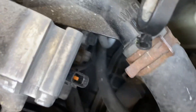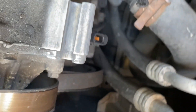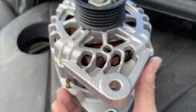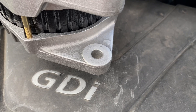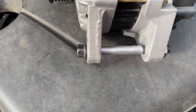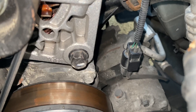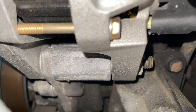You can see where I scraped all that coating off so it's bare metal. Flip this over — I'll show you what we did on this side too. All nice and clear, so that way it bonds to the mount nice and clean. Also cleaned this bolt really well — it had junk on it — so we have nice metal-to-metal contact mounting onto clean metal as well. With the alternator installed, you can see we have a nice, clean, secure connection — the alternator onto the engine block. Everything is nice and tight.